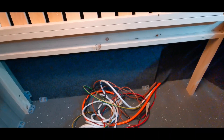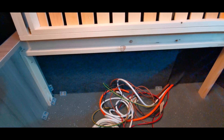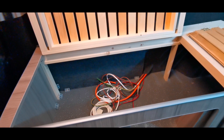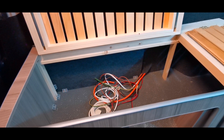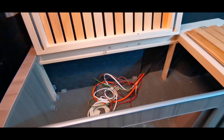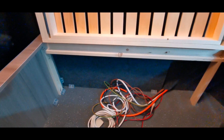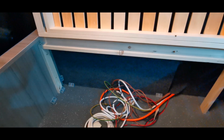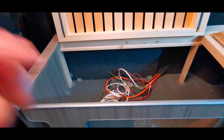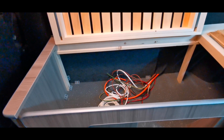I've got the consumer unit to go in there as well. I've upgraded to the 20 amp because I've got the bigger battery, and with the motors I'm going to be fitting to the roof for the elevating roof, I wanted a bigger battery. I wanted to upgrade the charger as well, just to be on the safe side. So we've got the split relay to be wired up — 12 volt, 240, the charger, the battery — and everything's going to be done on a time-lapse, then we'll move to the kitchen side.